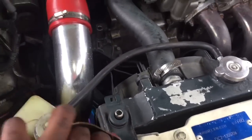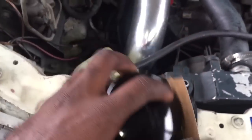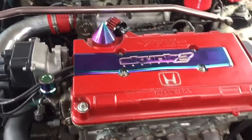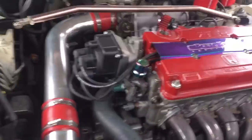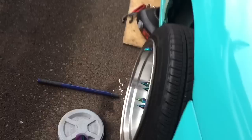I'm gonna crank this up. I'm using 5W-30. Got a new filter right here. Got my gloves just because I don't feel like getting dirty. I'm actually gonna take the oil cap off — that's gonna let it flow out faster. So we're gonna take that off and get this draining.